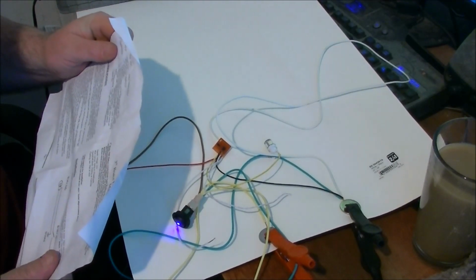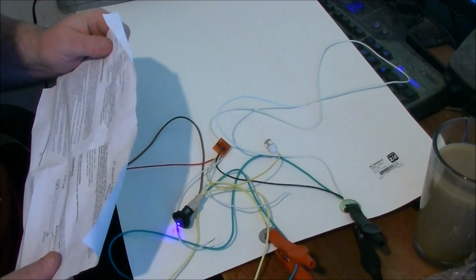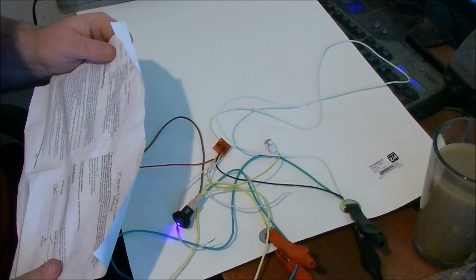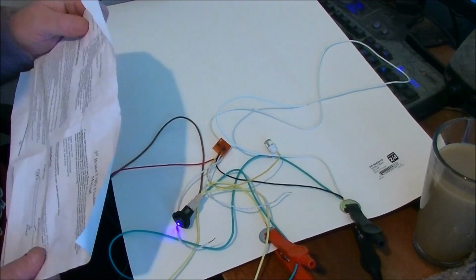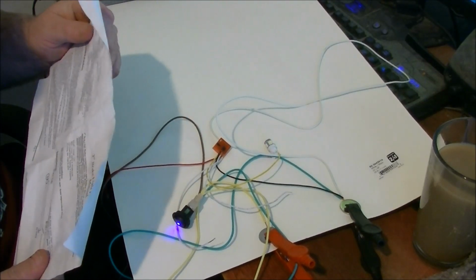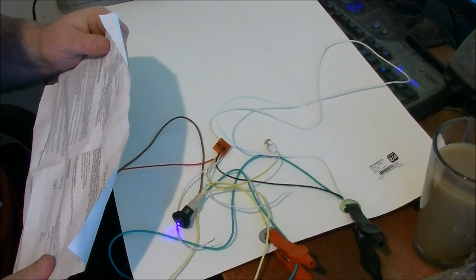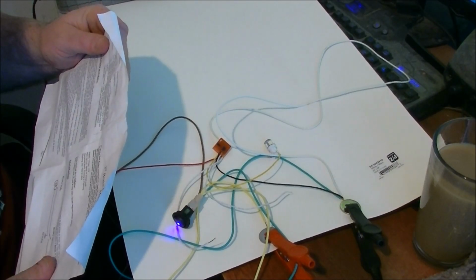With continuous mode selected, light will cycle through flashing pattern with preset delay. So with mode set to number 1 and brake continuously engaged, light will cycle through flashing sequence, wait for 6 seconds and repeat. In mode 3, repeat of the flashing pattern does not happen until vehicle brakes are disengaged. With continuous mode enabled, the activation timeout is disabled automatically.